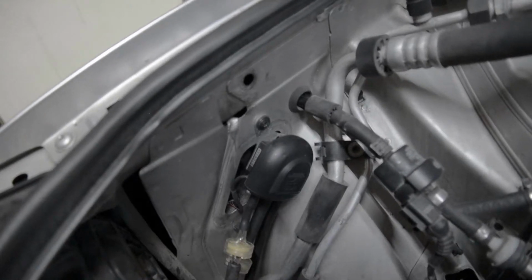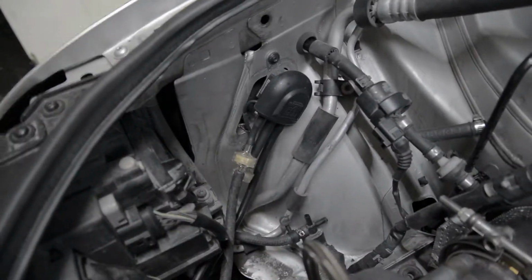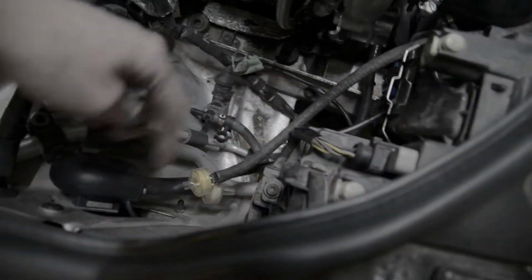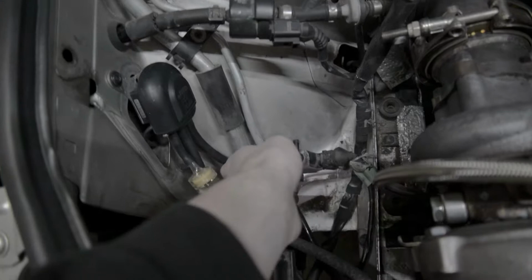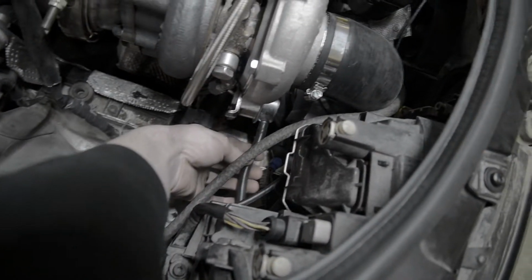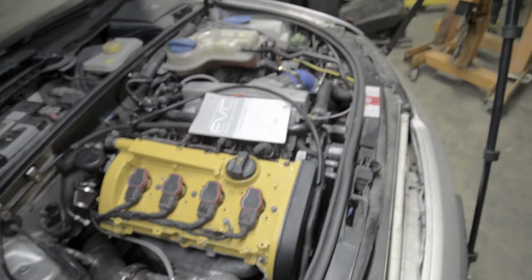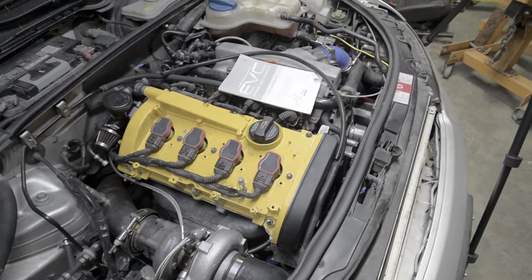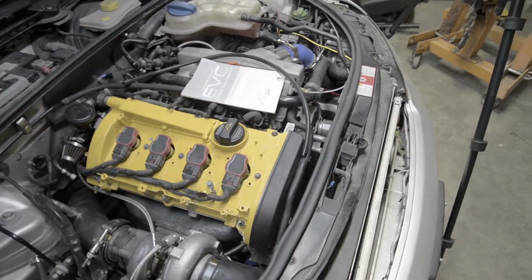So I just found a bolt there that wasn't used in the fender, mounted the controller there, and then I've run the stock pressure line into the B, and then I've got the O going directly to the wastegate there. Now all I have to do is find another pressure port and run the wastegate pressure to the controller, and then the vacuum part of things is done.